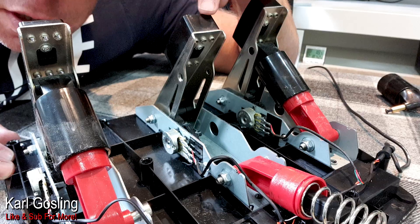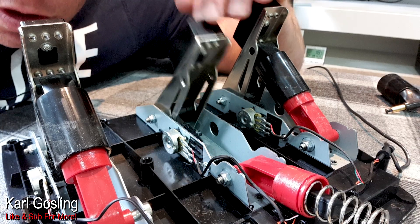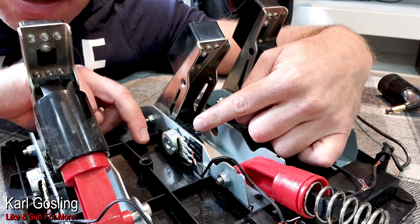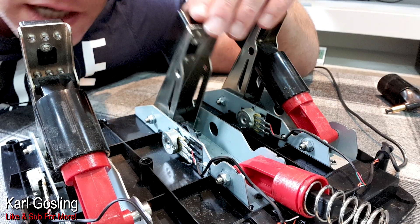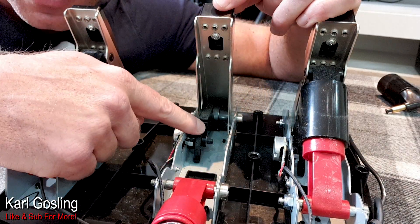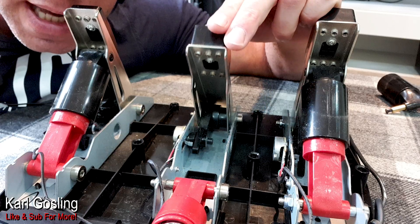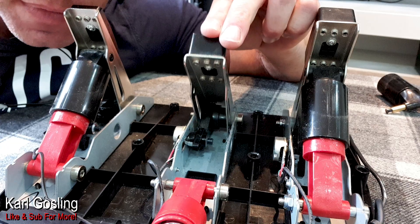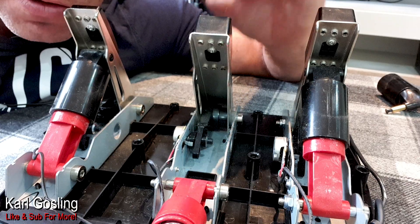I've disconnected the spring and what have you from the standard pedal. You can see we can just move the pedal all the way up and all the way down — I can put it halfway, three quarters, a quarter, it will sit wherever I leave it. What that's doing is on the back of this potentiometer there's a little lever attached to a little rod that runs through — it's just rotating it, same as rotating a volume knob. There's just some teeth that engage on the back of the pedal with a little arm on the back of the potentiometer, and as you move it up and down, it's just rotating the back of the pot. It varies the voltage based on the position of the pedal.